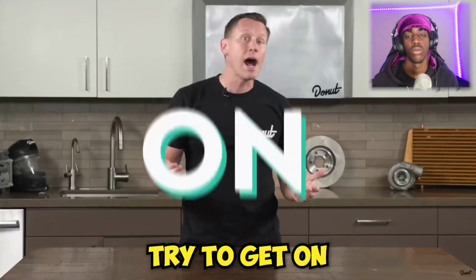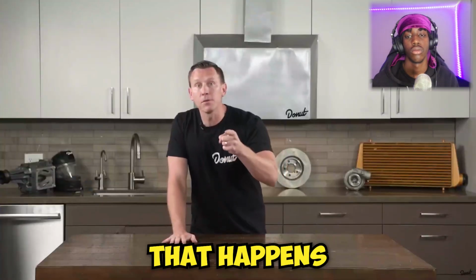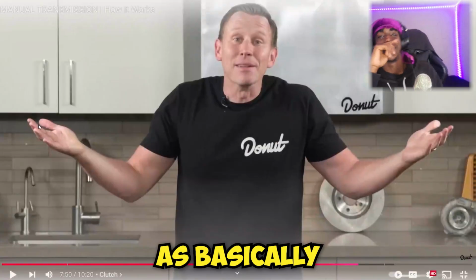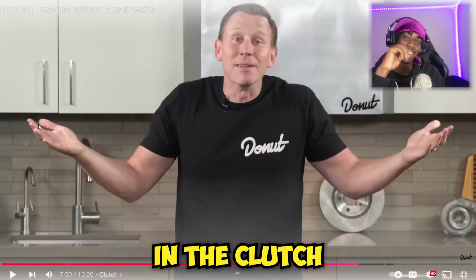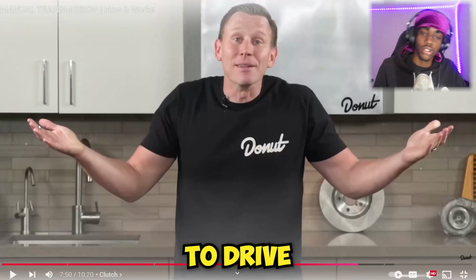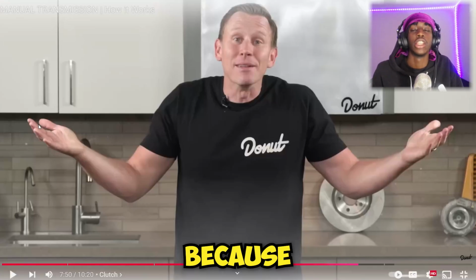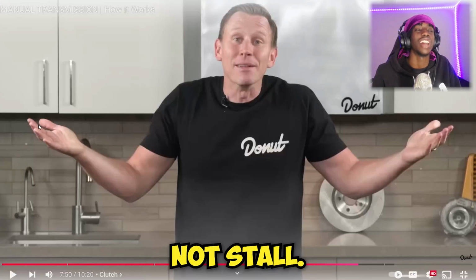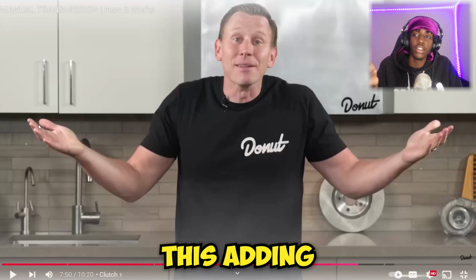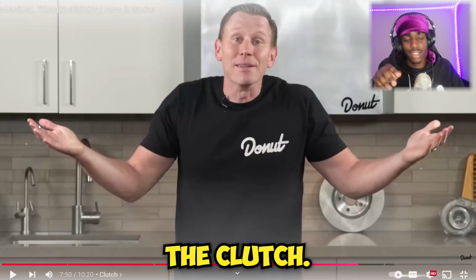You want to try to get on and off your clutch pretty quickly, or you might burn it out. That happens when the flywheel and the friction plate rub together too much. That's basically meaning when you ride the clutch. That's the good thing about watching these videos. A lot of people, when they learn to drive a manual transmission, they ride the clutch because it helps them not stall. They think it's helping them not stall, but it's really just adding a lot more pressure on your clutch than it needs to be. But when you ride the clutch, let's see what he just said.